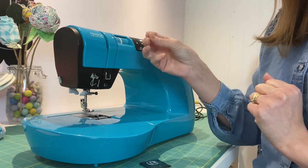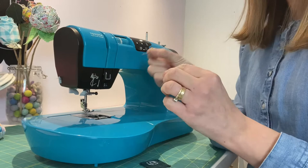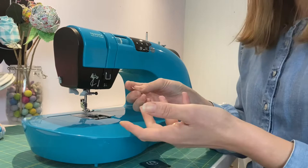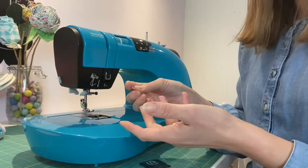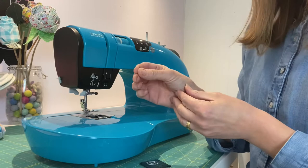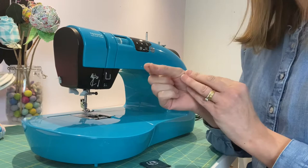Because I've been doing quite a lot of sewing recently, I'm also going to change my needle. This is a universal needle and I've been sewing cotton, so I'm just going to take it out. It's been in there a good few weeks. There are a few telltale signs your needle may need changing: it may start skipping stitches, you may almost hear it punching through the fabric, or on lightweight fabrics the threads might start to pull. If you can't remember the last time you changed it, it may be worth a change when you do your machine TLC.